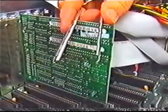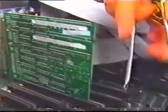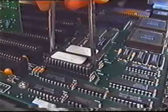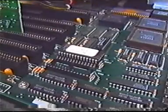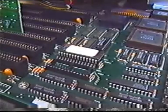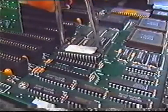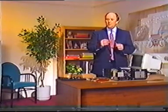Use a chip puller to loosen the existing ROMs from their sockets. Be sure you insert the chip puller under the chip and not under the socket. Once you've loosened it, remove the chip the rest of the way, being careful not to crack the chip's case or bend the pins. If you must set the old ROM down, place it carefully on a clean surface. Most technicians put the old ROM chip back into the packaging in which the new ROMs were shipped, to protect the old ROMs in case you have to reuse them later.